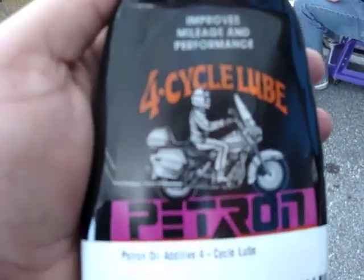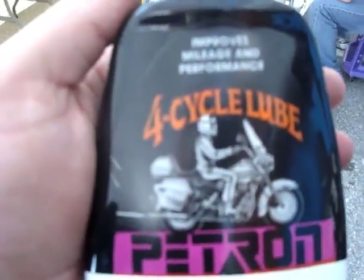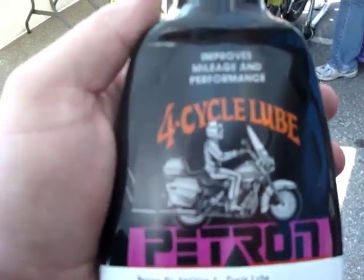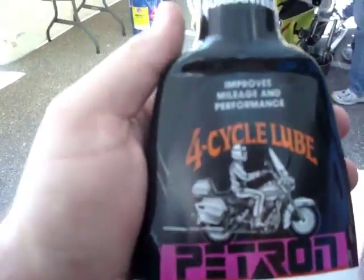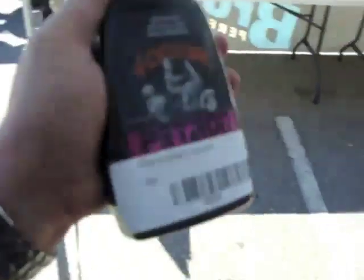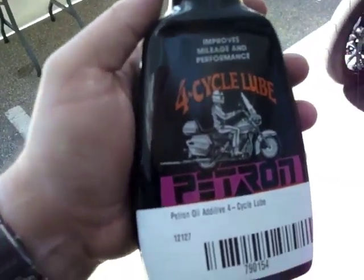I've been using the Petron for about 10 years, maybe more. I use it all the time. It's a great way — especially if you're drag racing — to increase your clutch life. I've actually made passes down the drag strip where one of my crew forgot to put oil in the bike, and it was fantastic. I use it as additional insurance. We put it in every other oil change in very serious applications; for a big stroker engine with a billet crank that's hard on bearings, we run it all the time. In street applications we may only put it in every third oil change. It has solids in it, so it's very important to shake the bottle. We're going to put it in the bike and immediately go for a ride — 5 to 10 miles is all you need — so the solids don't fall down into the bottom of the oil pan without getting run through the engine.